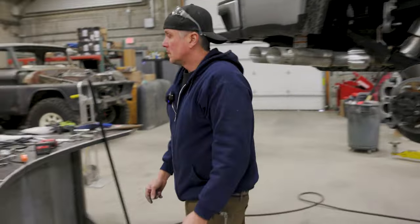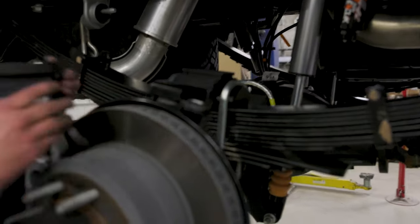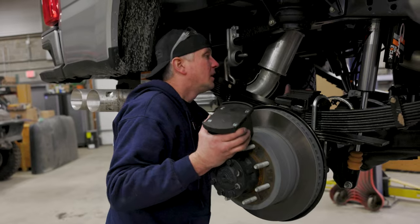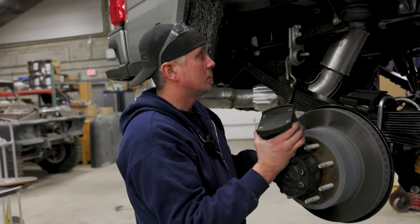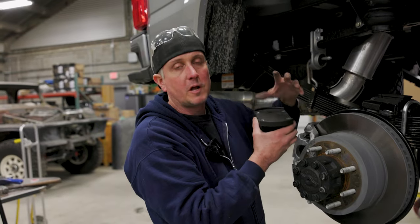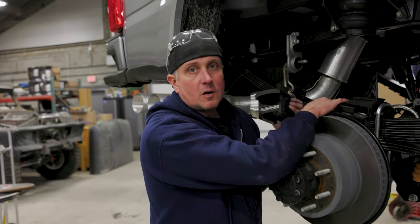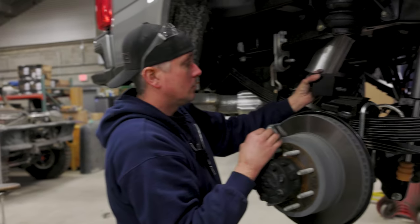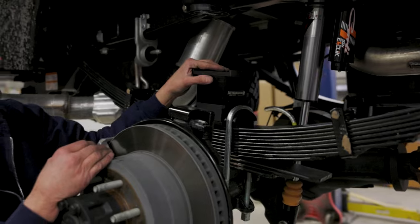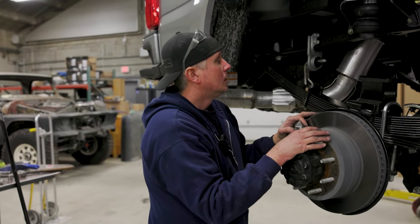This is the landing pad for the whole situation. The premise is: you have the suspension with all this travel — this Carli kit has around 10.5 inches of wheel travel in the rear, which is quite a bit. Normally with an airbag you can't get that much travel — you'd either be over-extending the bag or bottoming it out. With this kit, you can have full suspension travel as-is, and then when you go to tow your boat or trailer, you put this bracket in. When the truck gets loaded, it comes down and rests on that cradle, and that's when it helps support the load.